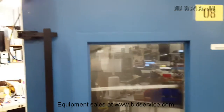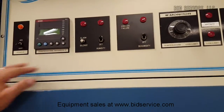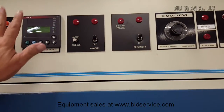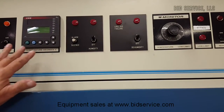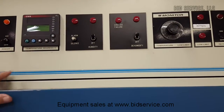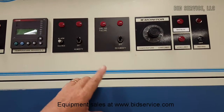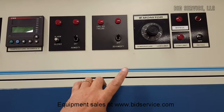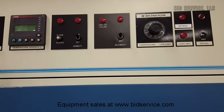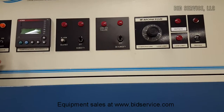It also has an upgraded controller — it now has an F4 controller. We had to modify some of the internal circuitry to work with this controller. As you can see, there was a defrost mechanism in here that's no longer necessary. The controller is handling that, and the indicator which was labeled defrost is now called bypass, indicating the bypass valve.